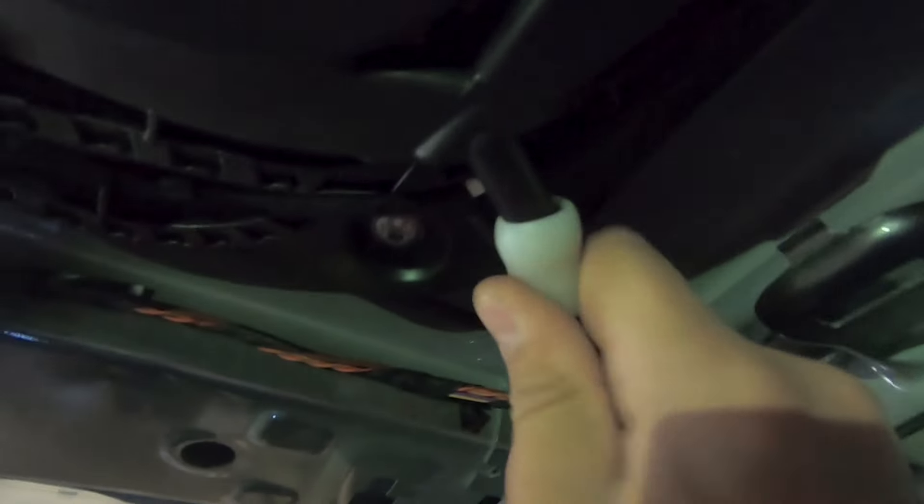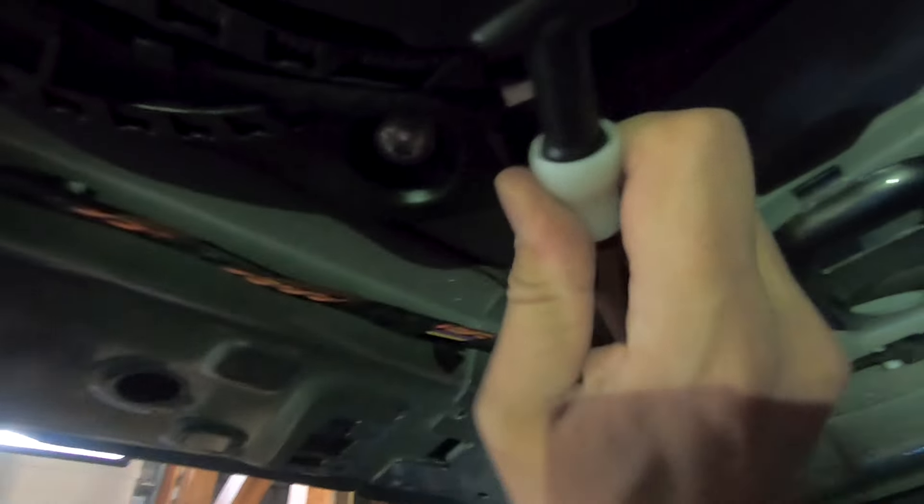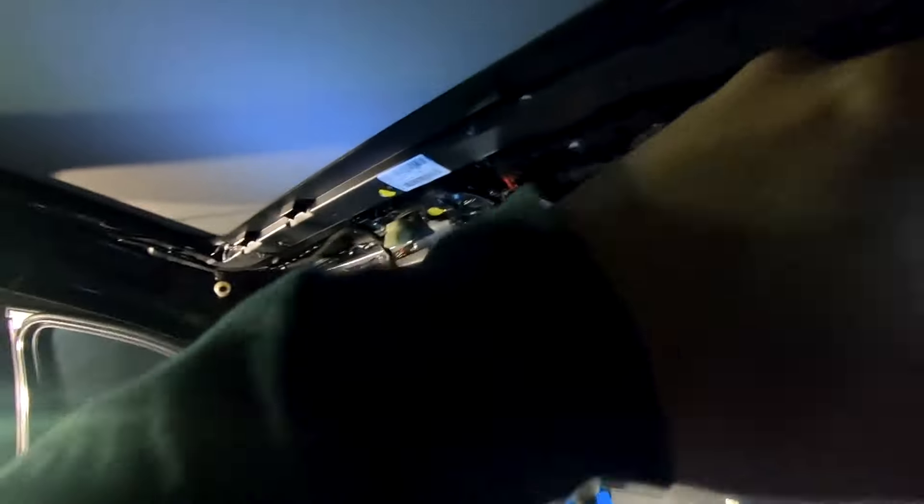To get the sunroof off, first things we're going to do is actually unhook these water runoff tubes or channels. There's four — one at each corner — so we've got to get those undone. Once that's done, we've got to get all the electrical plugs undone and get that off. Alright guys, we've got the sunroof out — put a blanket on it — and that's going to give us the ability to get underneath and work this roof dent. The PDR guy is coming on Saturday.